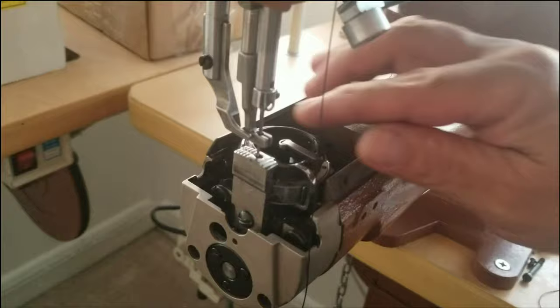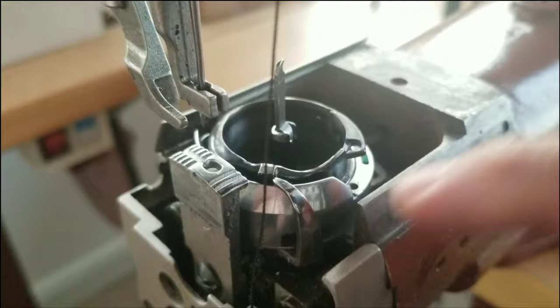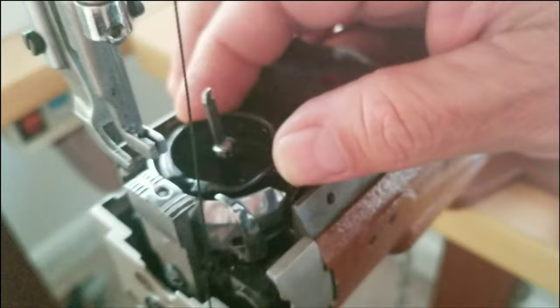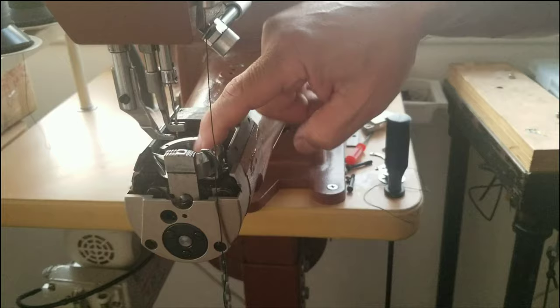Once you get it moving where you can get your fingers on it, open the little lever and open the lock. This piece of the hook assembly and the little protrusion where the thread comes out — in about this position is the sweet spot where the bobbin case will come out of its cradle. At any other point in the revolution the bobbin case won't come out, but the minute you rotate to a couple degrees past that little point, the bobbin case will just come right out. Take the case out, clean it off with a paper towel, get that thread out of the hook compartment, and you should be good to go.